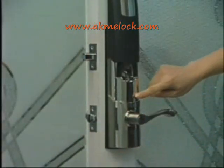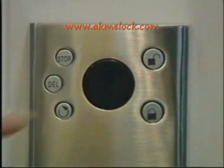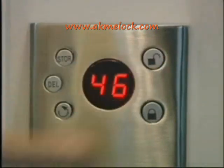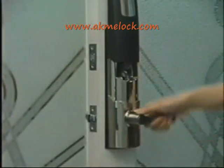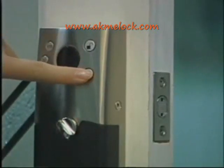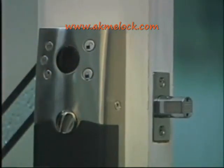Now I will introduce the setting to unlock mode. Quickly press the circle button twice and press the unlock button. You will hear a prompt beep. The system power is off, and the deadbolt and latch will be set to unlock mode. To cancel this mode, press the lock button or outdoor locking button.